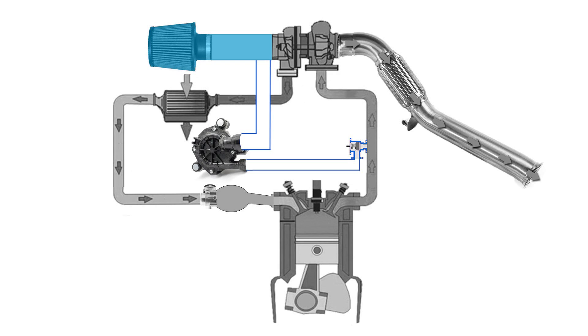Let's go through the basic flow of a secondary air system. We have a diagram here laid out for a turbo car, because a lot of mainstream VW and Audis are turbo cars. This is a general overview — not specific to any certain model or engine. On cold start, the vehicle determines that it needs secondary air. Air flows in through the intake, the secondary air pump turns on, and air moves through the intake hose into the pump, then is forced out into the combination valve. The combination valve is now open, allowing air to flow into the exhaust and out to the catalytic converter.